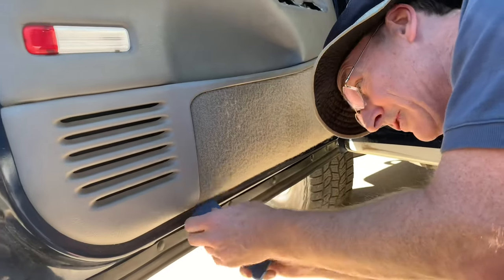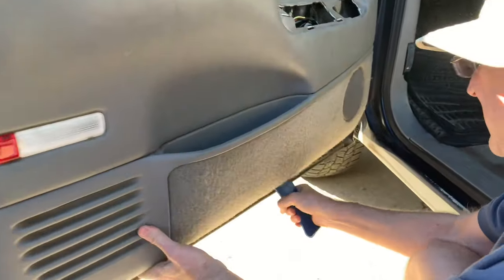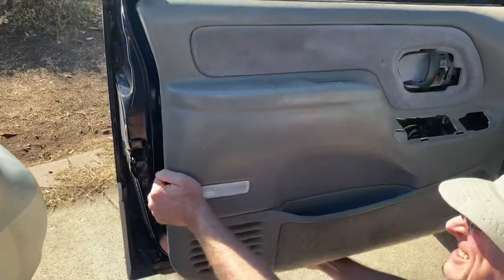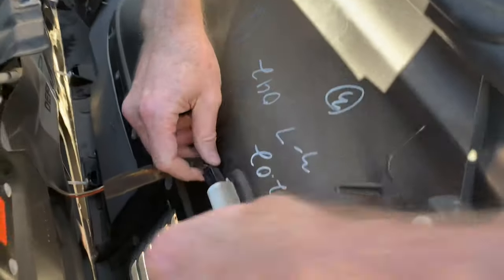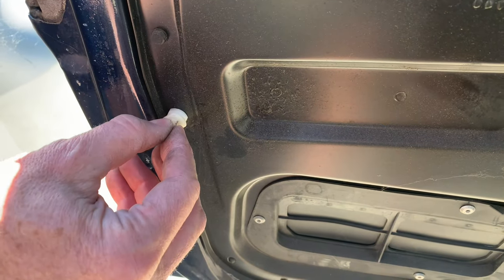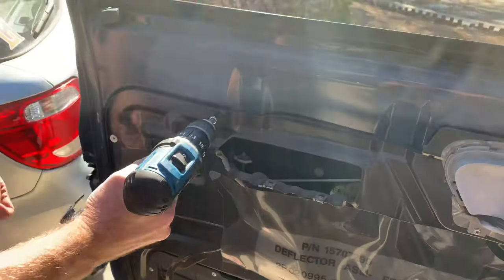The rest of this is just held on by little plastic clips that pop out, so we'll stick our trim tool in here. It's going to sound like you're destroying it, and we might be breaking some of these — that's why we brought the extra ones. There we go. Now this light — we could have pried it off and unplugged it from the front, but I'd rather unplug it from the back once it's open. Just pull the bulb out. Now we remove all the bolts that hold the interior panel — seven millimeter, one through five, and all around, so we can get this plate to hang forward. Little screws all the way around except for one big section in front of the speaker.